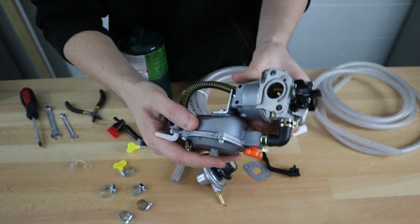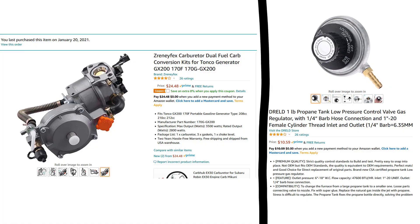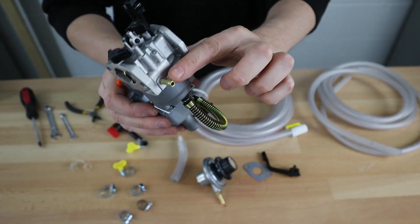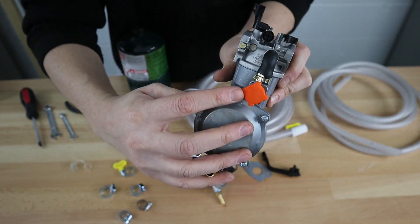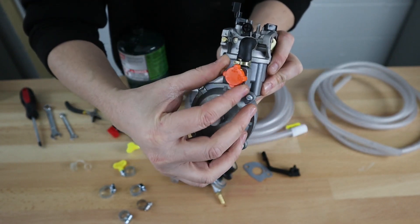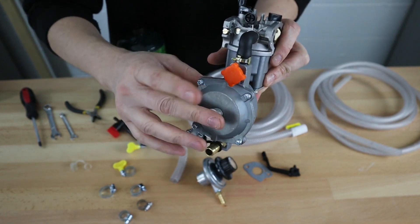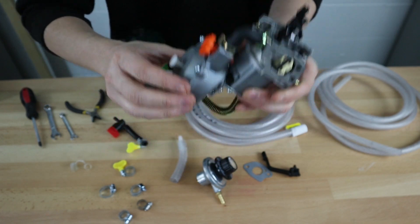Pick up your carburetor. This carburetor I picked up off of Amazon. Although called a dual fuel carburetor, it actually allows for three different types of fuel. There's gasoline that comes in through the side, and then there's liquid propane gas or natural gas, and you just switch between the two. I'll show you something coming up where you need to be very solid as to where this is adjusted, or it's not going to work for you.